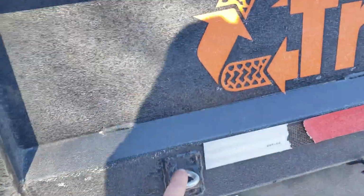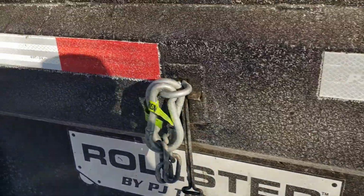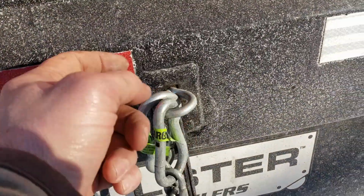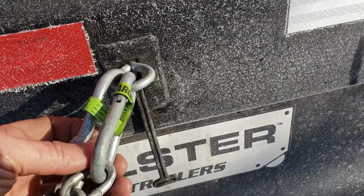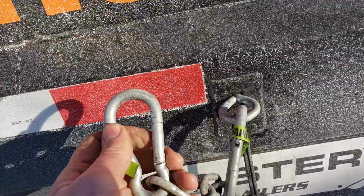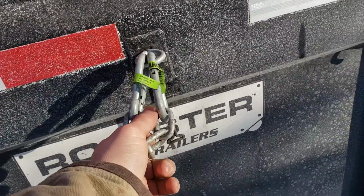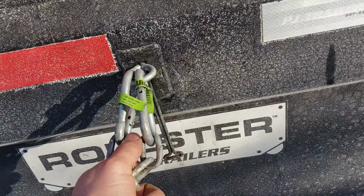They're those little T-bars. First thing you do, get yourself some eyelets. As you can see, you just bolt them right through, cut the excess off. Put an eyelet here where it used to be, just cut that stupid thing off there. Put a little bit of dog chain, 4 links, and 2 of these little snap hooks. It will never come loose. You will never lose the door. You will never rip a door off. You will never bend a door if you do this.